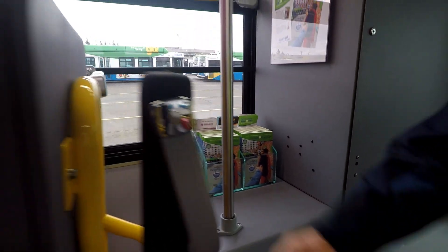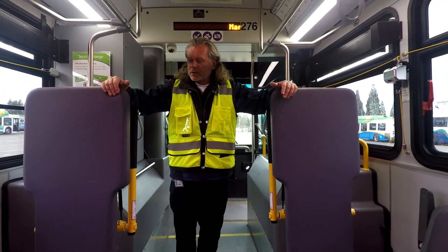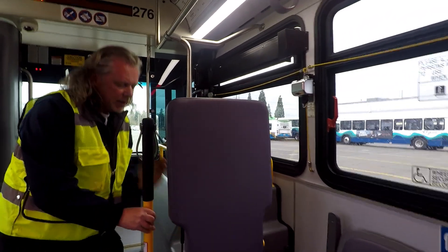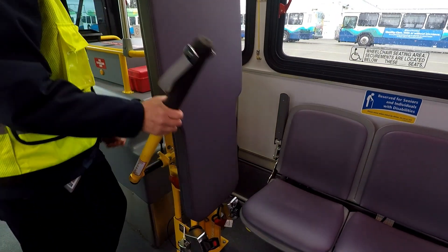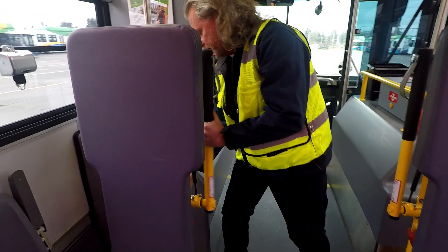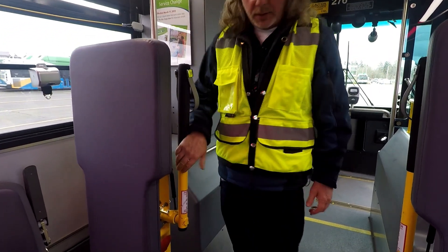As I come through the coach, I want to look at my wheelchair securement area. This coach actually has two types of securement. We have the passive restraint — we want to make sure this works properly, so we pull this handle down and that works good. The passenger just pulls up in there. That works good. We'll check this one as well — push the lock lever, handle down. That all works good.